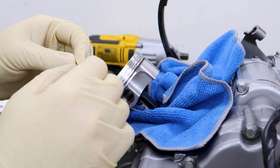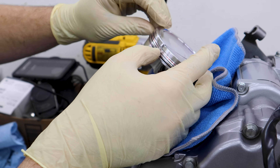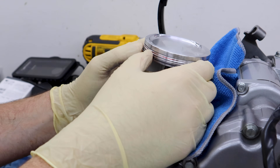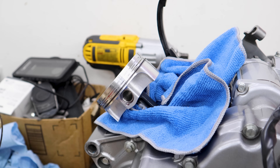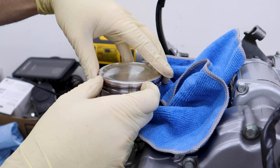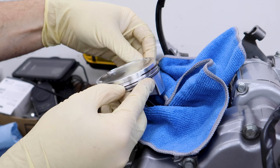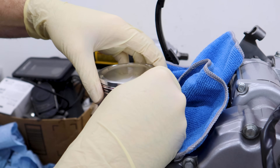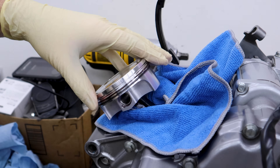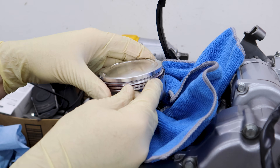You don't need to get crazy trying to degree the ring gaps exactly — get them close, they're going to move anyway. I'll put the gap of the first compression ring toward the intake. The next ring is marked T2; run a little oil around it, clock it to a different position, and work it into the groove naturally rather than overstretching it. I've never broken one of these but I've seen it happen. The last ring goes on too — T and T2 don't necessarily always mean the same thing across manufacturers.